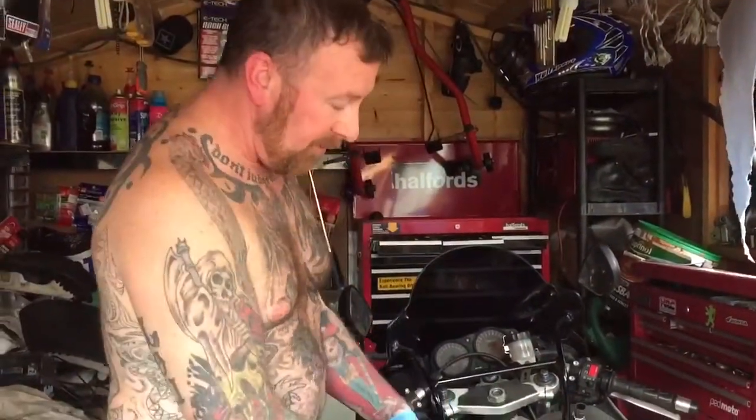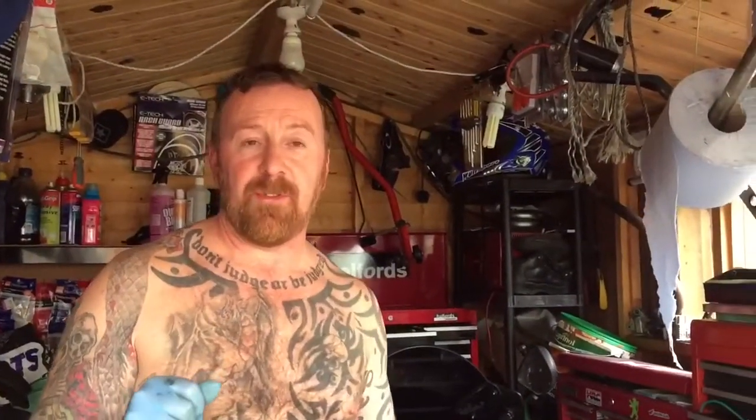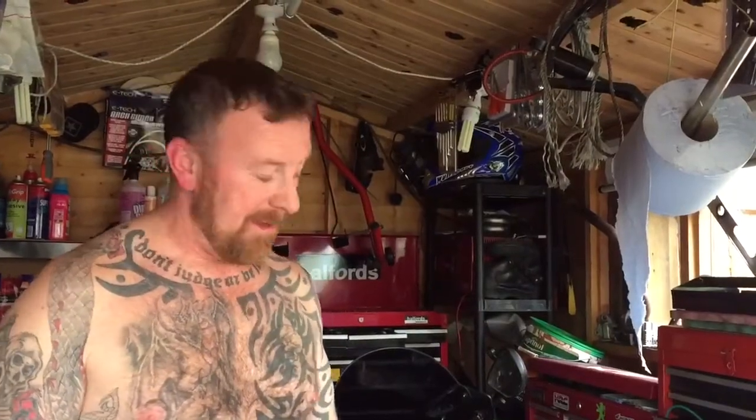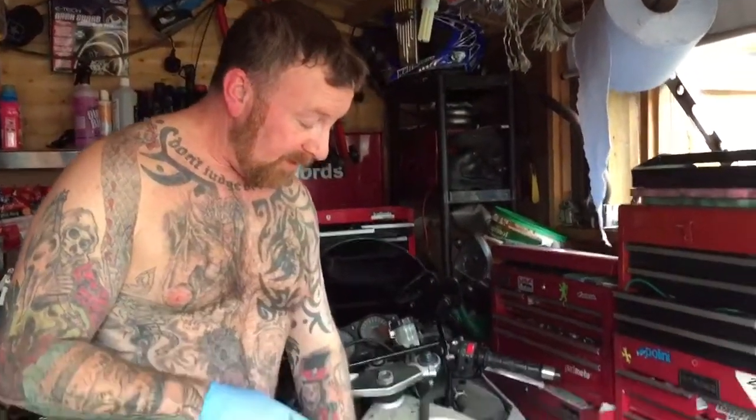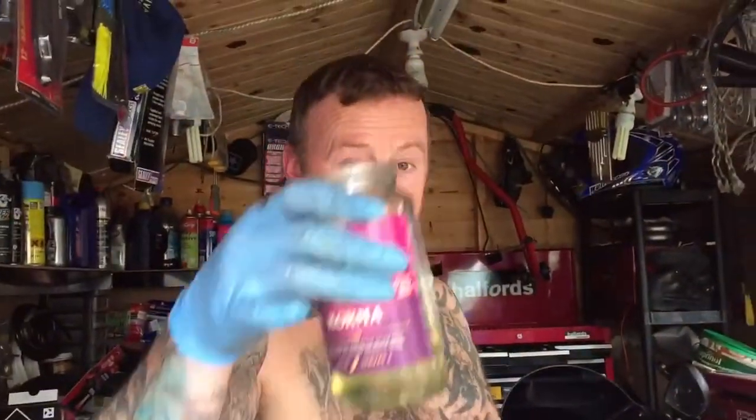Personally I can work this way without completely removing it - it's nice and clean. Make sure you replace the rubber seals because there's no sense getting it all back together and thinking it'll be alright, because it won't - it will leak and just won't run. In another video you could hear she's running on three cylinders, making a noise. It would run but didn't like it.